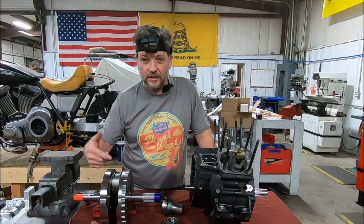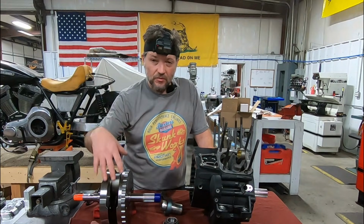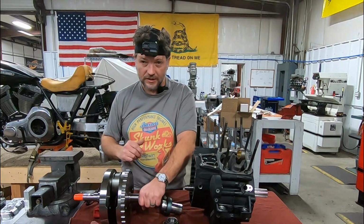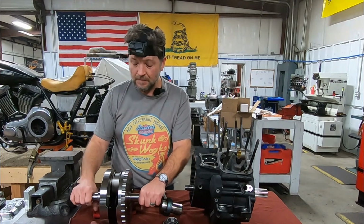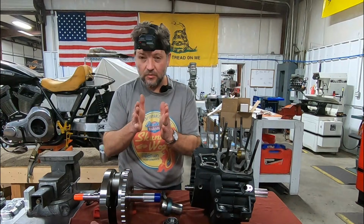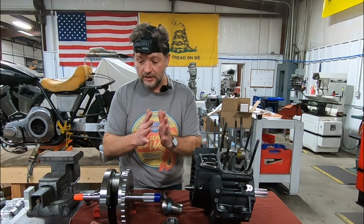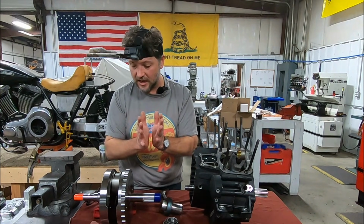You'll also see that it's welded. As this assembly is rotating, the pressure revolves as the flywheel is spinning. But then you also have the tremendous forces on this side, with this side kind of just going along for the ride. So it's quite possible that these flywheel halves can shift and scissor in this direction. They can also flex in this direction, inside and out.